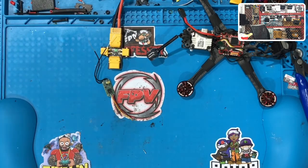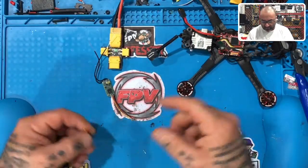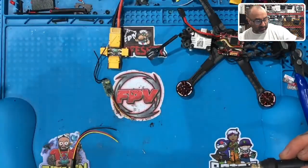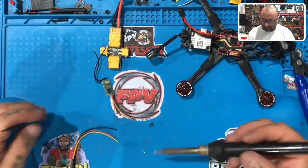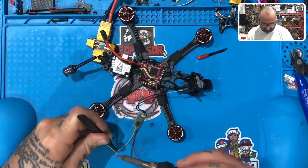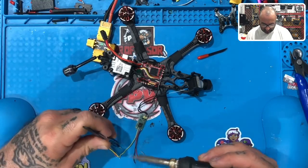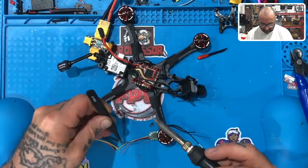Found it right here. I'm gonna use this one because it's already been cut and soldered, and I don't want to ruin the pins on the other one so I can still plug it into a receiver that hasn't been attached yet. So let's just get to it — we're going to solder wire to wire: yellow to yellow, red to red, black to black.